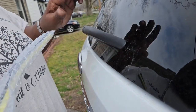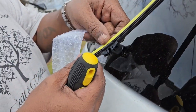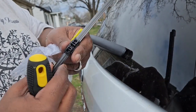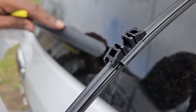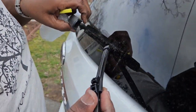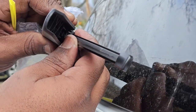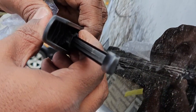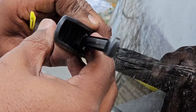Be careful when you put the arm back down. Take your new wiper out and make sure you remove the cover that's on your wiper. If you see right here, this is a lip — they actually click onto here. You don't need your screwdriver anymore. Lift this back up, look and see exactly where it needs to go, which is right here, and just push it in.